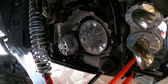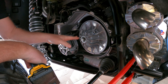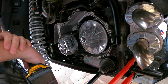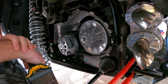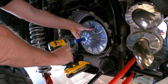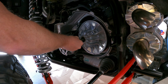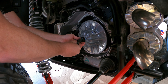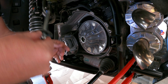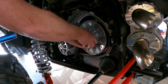I'm going to go ahead and pull off the secondary here, and then we're going to test this when we're done. Right now this doesn't move at all when it's in idle, so it's perfectly still. We'll see if it needs adjustments after we do this install, if I have to reshim it at all. Go ahead and take off this nut here. Be careful when you take it off that you don't lose any of the shims — they are just little teeny, thin washers.